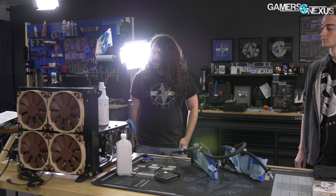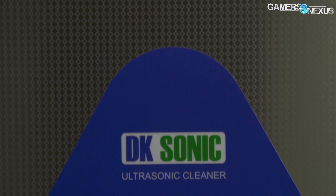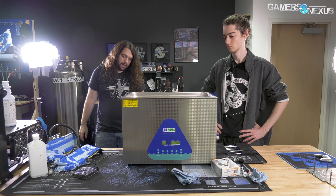We can control temperature on this one — it's the biggest we could buy on Amazon. You can special order larger ones, but this fits pretty much every motherboard unless it's XL. ATX fits fine, EATX probably not. We can control the temperature and they've got options for full-wave and semi-wave — full-wave makes it significantly louder, a really high-pitched frequency. It actually gives me a headache if I'm within a few feet of it. Degas cycles it, turning that high-frequency noise on and off. You can set a time limit too.